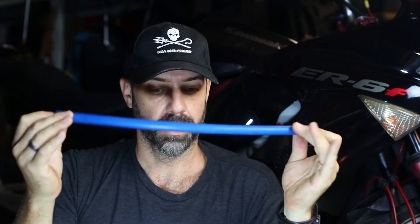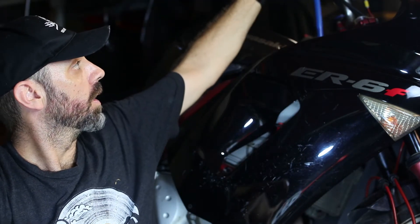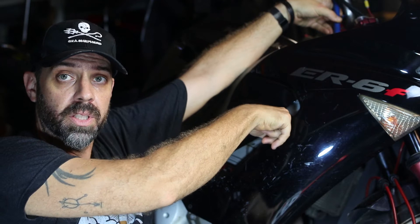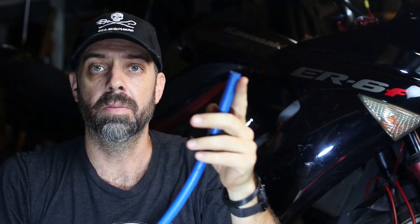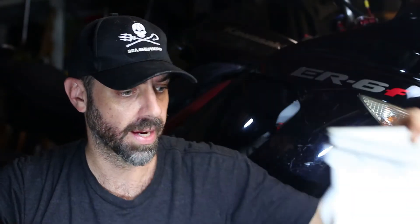It's really murky, it's gone a yellowy-brown colour — definitely time to change. What you will need: if you haven't watched my other videos, I'll just quickly share with you — you do want a piece of hose that's about 35 centimetres long, and a funnel, because that's going to allow you to reach through to the cap on your radiator, which is in there, without spilling too much coolant everywhere. A little pro tip for you: funnel, hose, and you'll definitely want some kind of bucket to catch your old coolant.